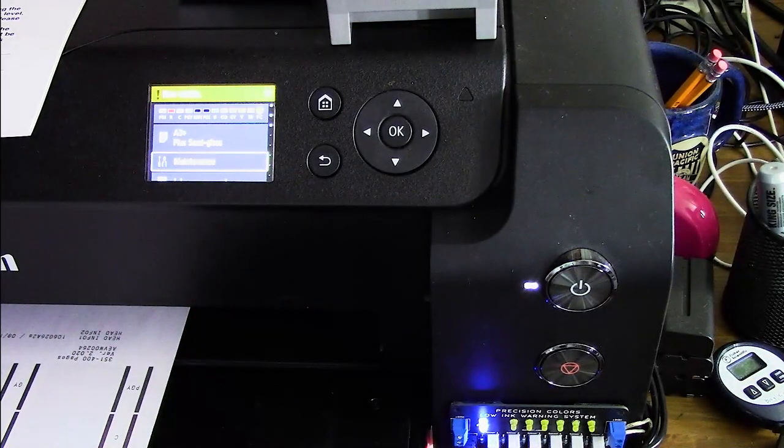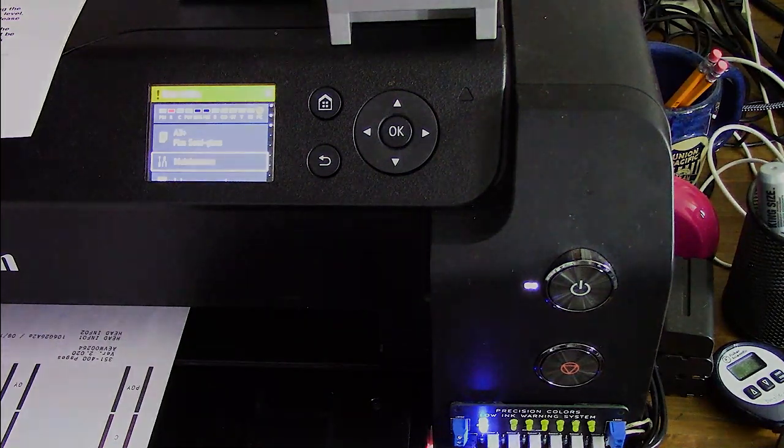Photo cyan is the next one to go — it shows one remaining. You saw how simple that was. If you do it correctly it really does work, and now we rely on our sensor system to keep us informed of how much ink is left. The cartridge may go physically empty on the chip — not on the cartridge itself — so you keep topping it off. You get a red X rather than a yellow exclamation mark, continue to print. At some point, just like the other one, you will get error 1753 — press the pause button five seconds, processing, and you then have another chip disabled.